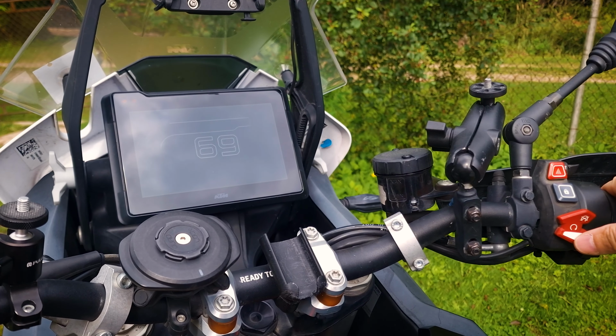Remove everything carefully so as not to scratch anything. The main thing to remember is that the upper fastening of the cage is not the longest bolt on this bike, but the middle one. The longest one is the one that bolts the tank. Here we are, finally getting to the fuel pump itself. I disconnected the high pressure fuel line and saw that the fuel was there, so an air gap was out of the question. I honestly thought that the pump itself was not pumping.